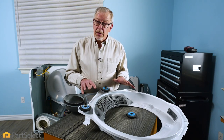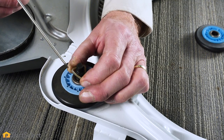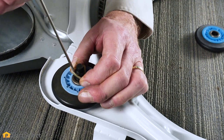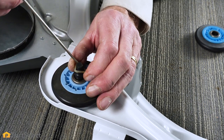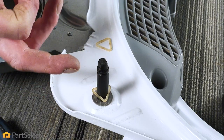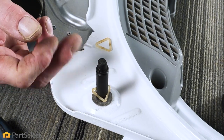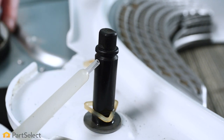With our bulkhead on a suitable work surface, we'll next remove the retaining clip for the drum roller. Depending on your model, it might be a C-clip, an E-ring, or one of these plastic triangles. We'll remove the old drum roller, then inspect the shaft for any damage or corrosion and clean it up. We'll put a few drops of machine oil on that shaft and then install the new drum roller.